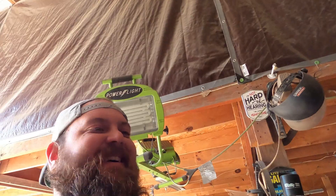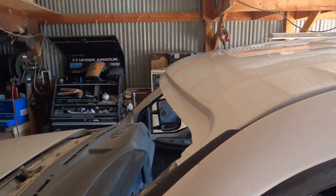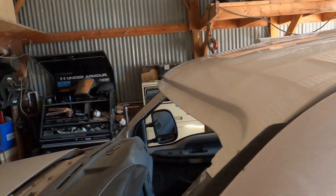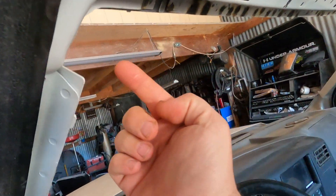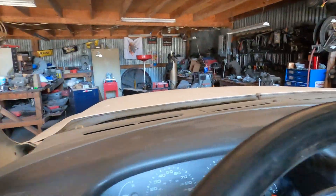A few months further down the line — we had to cut this roof off and replace it, which is a video coming out shortly. He just got done painting it. This whole section from about here down is where the water leak was coming from. Apparently it's a super common problem on these trucks: the windshield line rusts out and the water runs down the A-pillar right onto your circuit board. I realized I forgot to update this — I had my moment of failure there and thought I blew it and would have to order a factory one. Then I realized I'm just really dumb and forgot to hook up the primary power wire.